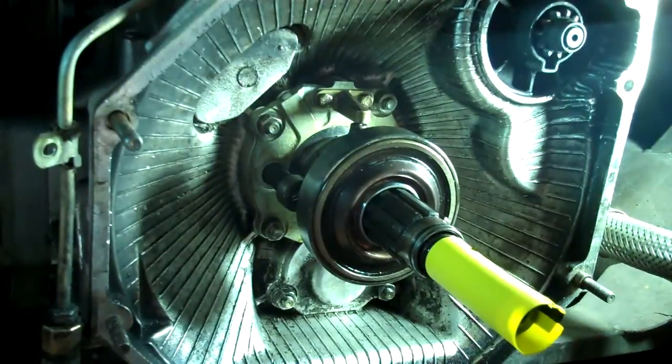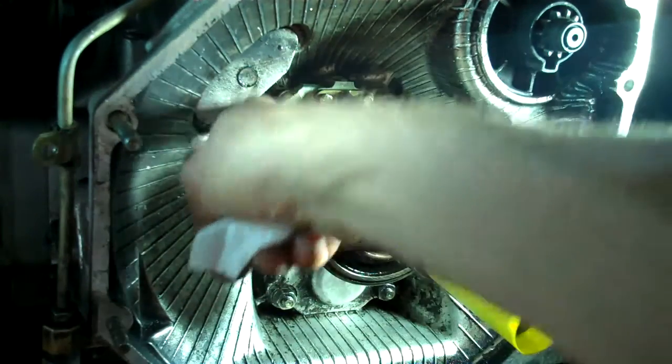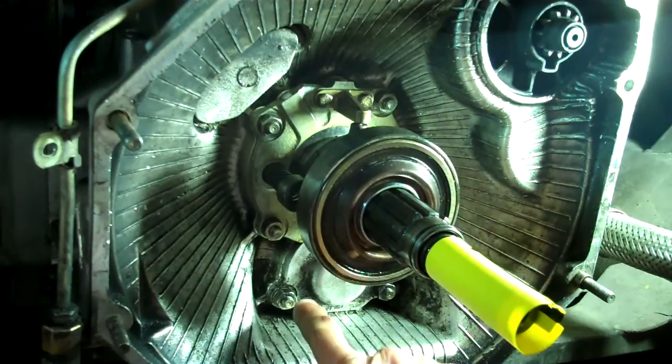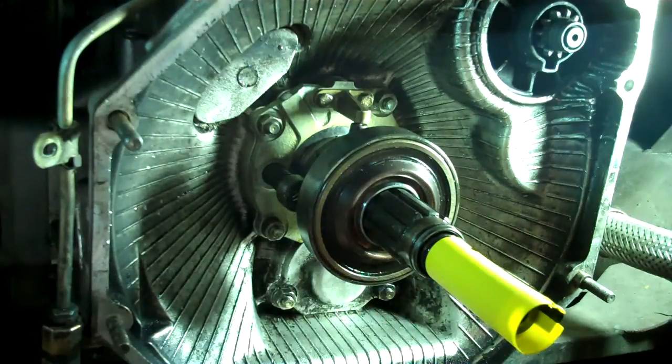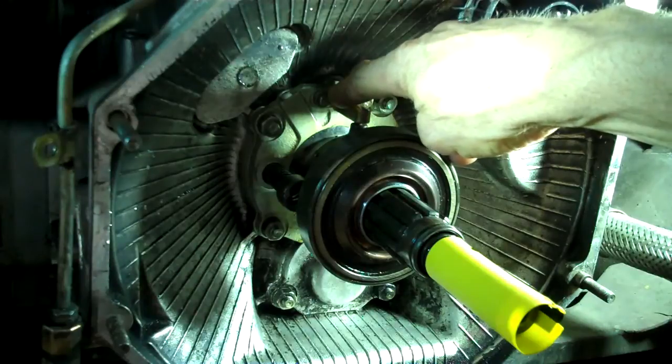Okay, while I'm waiting for my triple seals to soften up, I couldn't find actual torque specs for these bolts, so I did them at about 23 foot-pounds, which seemed plenty tight. I also have some part numbers. The O-ring that replaces the one for the little gear inspection plate is 131747. The triple seals that are currently being boiled are 137249.